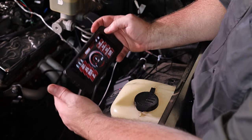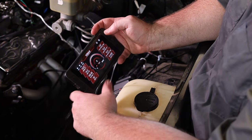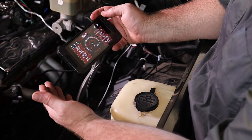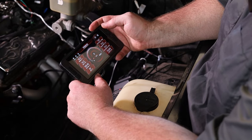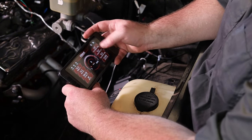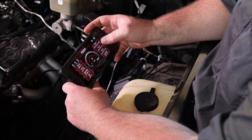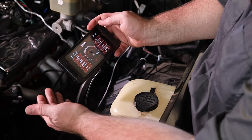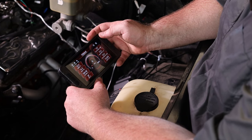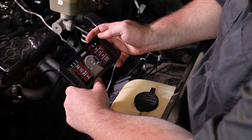The setup on this is not your normal setup because we are using a Hall Effect distributor with a CDI box. If you wanted to, there's a huge amount of combinations — you could do a coil negative, an HEI setup. But if you order this top end kit, the Kill Shot with distributor and coil and all that, they come with a magnetic distributor, which will be plugged in with that VR wire on the main harness — set up as magnetic in the parameters. To change from the Hall Effect to a magnetic distributor you'd have to go back through the parameters and select it as magnetic. Those also require being mechanically locked out before you install them to accurately do the timing control.